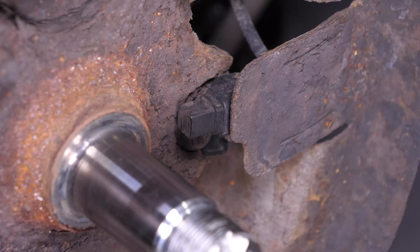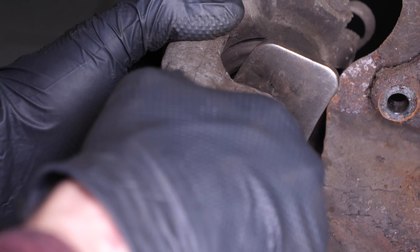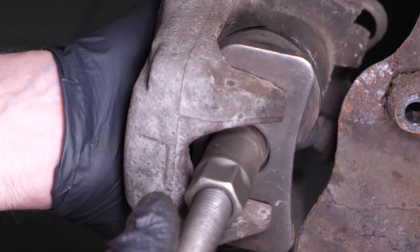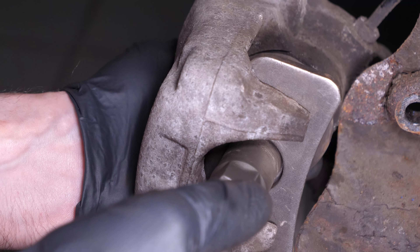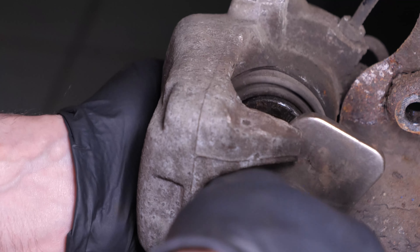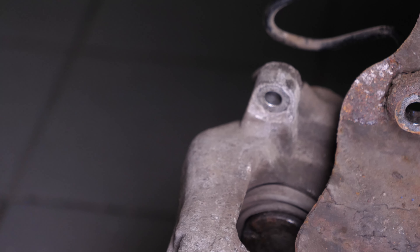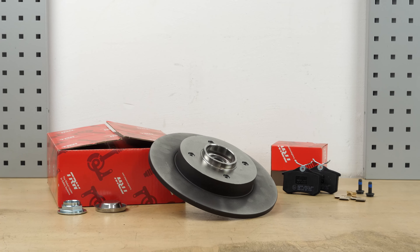You can also clean the ABS sensor with a brass brush so as not to demagnetize the sensor magnet. To put the piston back, you must have a brake caliper wind back tool — a specific tool that will wind the piston back but also rotate on itself to reset the self-adjusting system on your handbrake. All parts used in this tutorial are supplied by our trusted partners. Check them out in the description below — you will find the TRW parts and products used in the video in the link in the description.